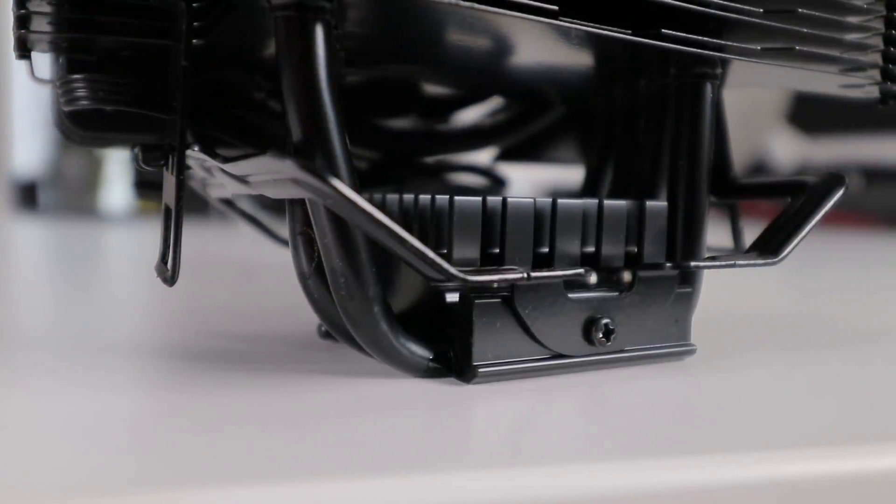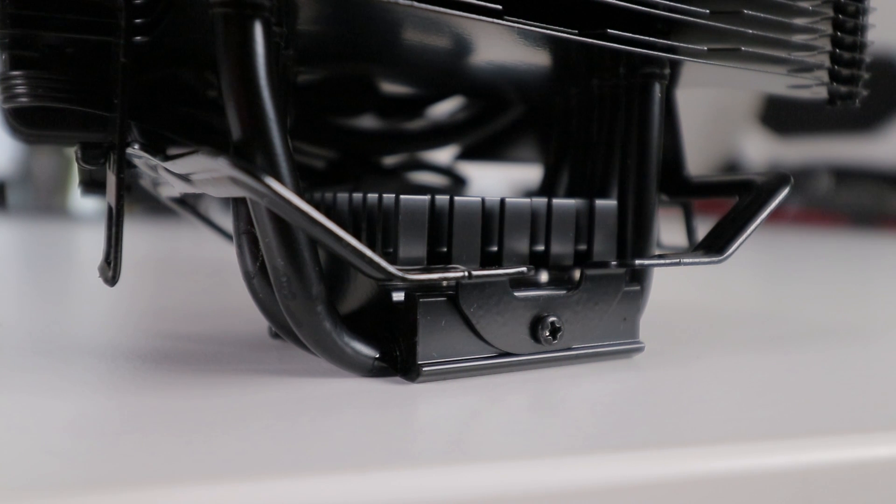I backlit the shot and sat the long side of an 840 EVO SSD on top just to give you an idea of the issue. It's not just the heat pipe and base plate gaps — you can clearly see deep grooves in the heat pipes themselves, which will require more thermal paste to fill, which will harm heat transfer performance. But it's fine; there's a heatsink on top compensating, sort of.